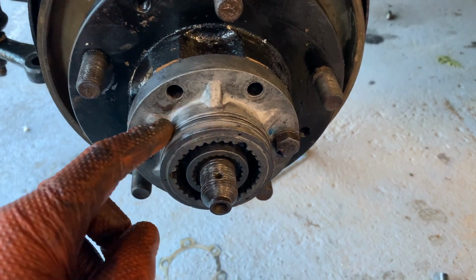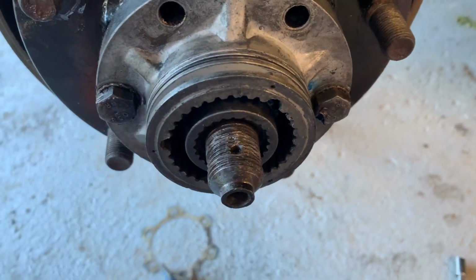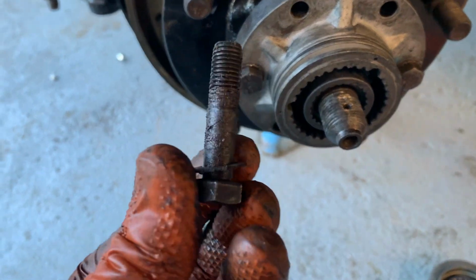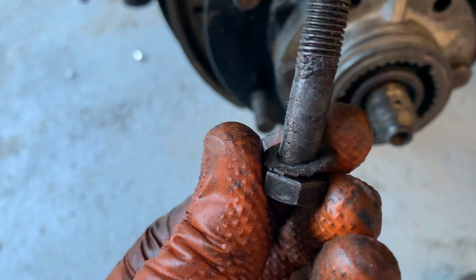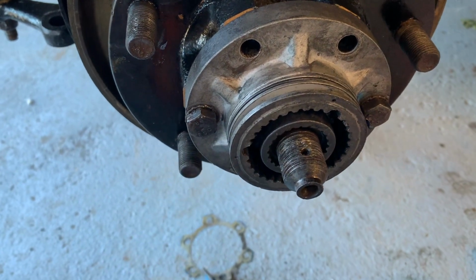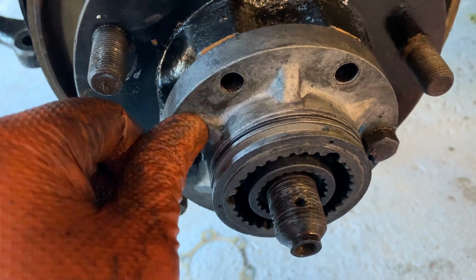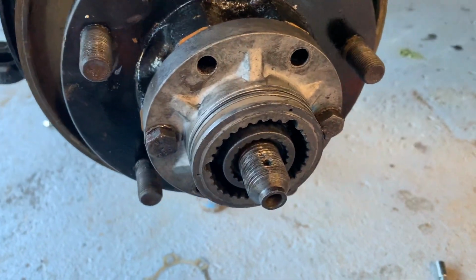Okie doke, so this is the main sort of flange plate on. I've only got the 2 bolts on here. I've just used brand new bolts. They're quite cheap, and you fit them with these little star washers which are anti-shake, presumably because you don't want the flange falling off. You can see the gasket sticking out there, quite sparing with the blue this time.